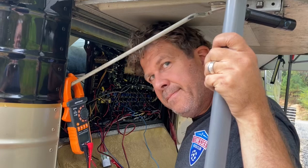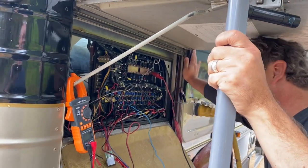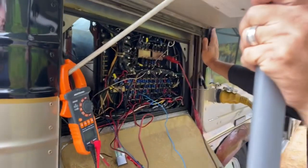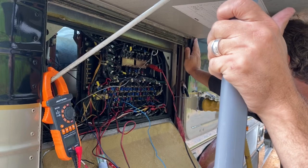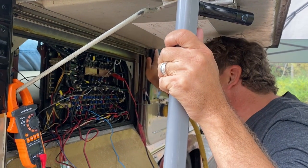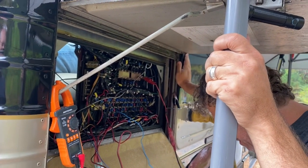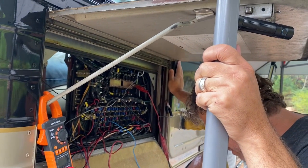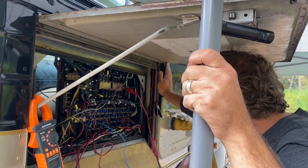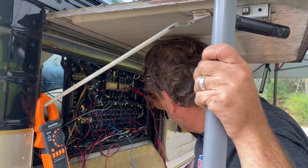Yeah. Our custom coach electrical specialist Lance is here to help us today. The custom coach conversion is a very complicated wiring system on top of the MCI system, which is already complicated. But so far we had an intermittent problem with the 12 volt system wasn't working at all with the switch up front. Lance figured out it was just a loose fuse holder, which only took us half hour, 45 minutes to track down.